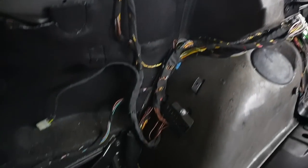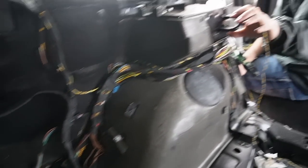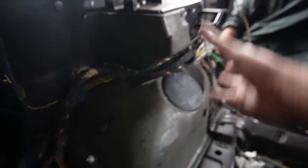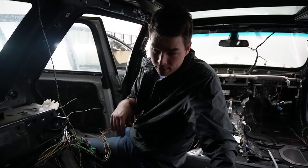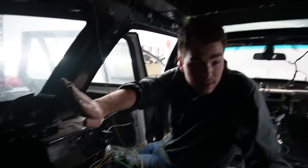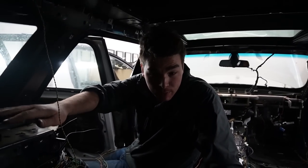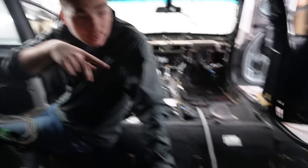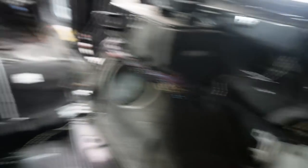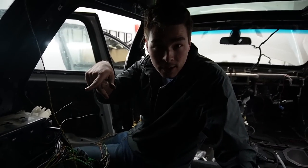Nick's been doing all the wiring while I've been doing the cleaning up work and making things look OEM. Nick's attention to detail is insane. The wire you see dangling is for the curtain airbag, so I'm going to start working on getting all the brackets up there and getting both curtain bags up. According to Nick, from this point back, if you were a technician at a dealership who ripped all this out, you couldn't tell that entire sections of harness were spliced in and modified for the M3 wagon.